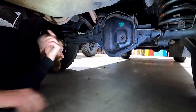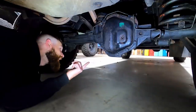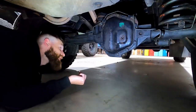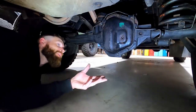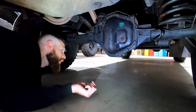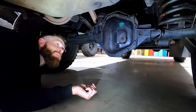Under here, if we're going to put 35s on it, probably going to have to strengthen a few bits and pieces. There are no lockers at the moment — you can get centre, front and rear lockers in these things. It does already have heavy duty flanges, and I think it has heavy duty axles on the rear, maybe — I have to confirm that. Anyway, I'll go heavy duty axles front and rear, and probably have to put heavy duty CVs up front as well, pretty early on before we take this thing too far off-road. Brakes are pitted and looking really shit, so there'll be new brakes all round.